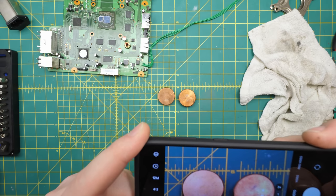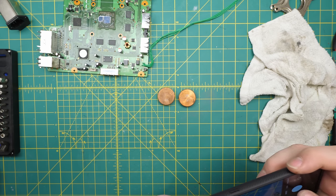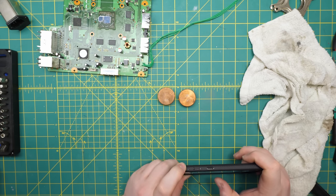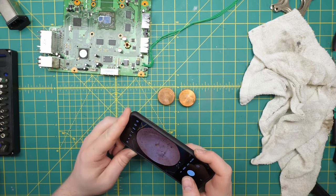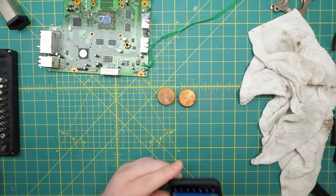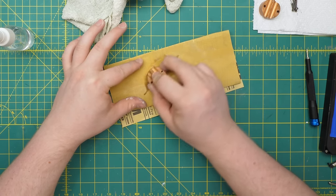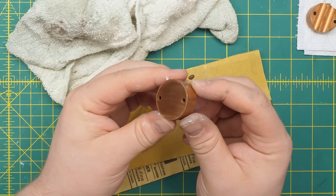The idea of reusing these things hurts. I was tempted to go beyond a simple cleanup — these deserve to be ground, sanded from 200 grit up to 2000, and then lapped. But unfortunately I can't. The point of this whole endeavor is to perform an experiment: I want to know if Niveus made something that could run games, and this is what they shipped, so this is what I have to test. If I improved it, it wouldn't prove anything. So as much as it pains me, I did nothing more than wipe these off, and I will later install them again in this exact condition. May God have mercy on my soul. This stung so much that I felt I had to do something — so after cleaning up all the grease, I found the slugs that sit on top of each tower and ran each one over a piece of wet 330 grit just until they were shiny on top.